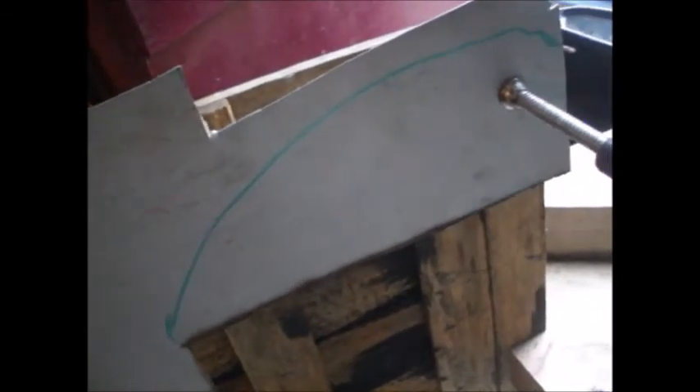Using the angle grinder gives you both hands free and you can cut off at whatever angle you want, cutting your basic shape out of the big sheet. Once you've got the smaller piece you want, it's easier to trim it up to the sizes you need. Always use eye protection when using angle grinders. As you can see it's a pretty good fit. I've got to paint it before I bolt it back on, so I'll give both sides a coat of paint — probably Hammerite because it has good weather resistance.